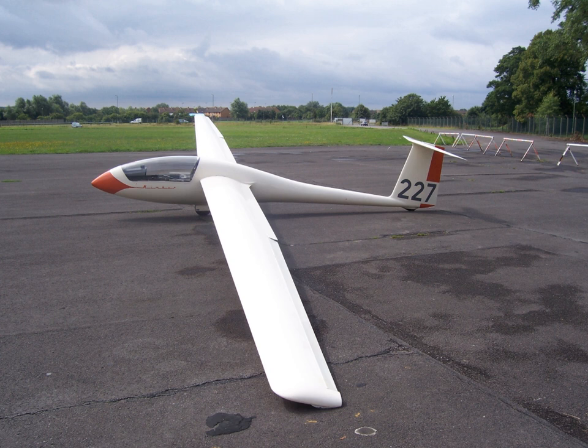Based on the standard Cirrus, the original Mini-Nimbus HS7 design had an all-moving tailplane and fiberglass wing spars. A tailplane anti-balance tab was a required modification for certification in the United Kingdom after flight testing by Derek Piggott on behalf of the British Gliding Association revealed very low stick forces and marginal pitch stability of the HS7 version.